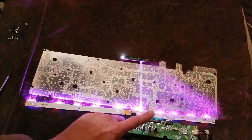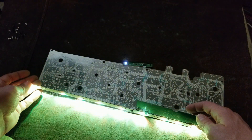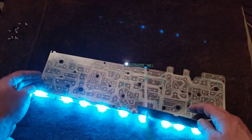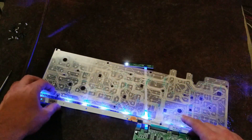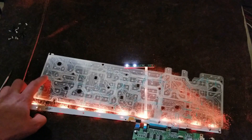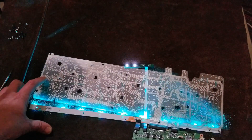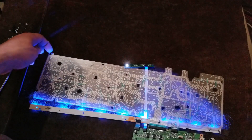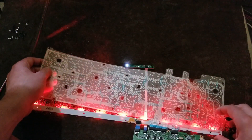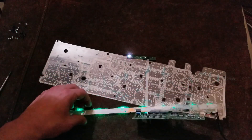Let me turn off the light so it's a little bit easier to see the RGB LEDs. They actually have two RGB SMD LEDs per zone — these are surface mount but they point 90 degrees, so they're pointing forward even though they're on the surface. This gives you an idea of exactly how big the keyboard would need to be. We can do our caps lock, our num lock — this is really how thin a keyboard could be made, super duper thin, even with RGB. So it kind of annoys me when manufacturers give you these huge platforms — there's just absolutely no reason for it.